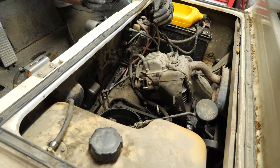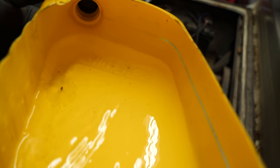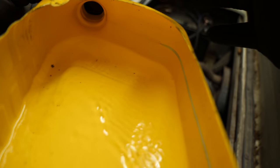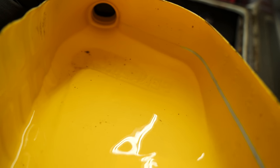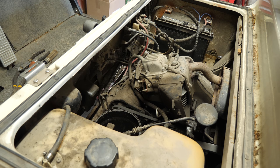We have to prime the fuel system. I would like to do that now because when I put the carb on, I don't want to have to do it then. Now I don't know if you're going to be able to see this, the glare, but you can see the water — if you look down by the Pennzoil logo on the front there, you can sort of see the water, how it just sits down on the bottom. Everything else in here is gas. That's the stuff our internal combustion engines do not run on — water. We need water for life, but it'll actually kill our internal combustion engines.